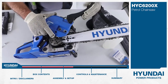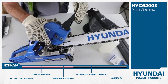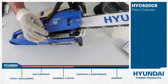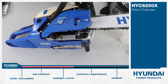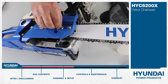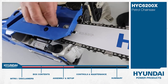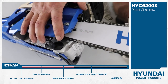So again, to fit this, we need to make sure that the brake is in the off position. I've just put this back on, but that's the off position. Away is the on. So now I simply locate this over the 2 bolts, just gently, and it should sit into position. So I'm just going to remove one of my gloves for this. I'm just going to refit these 2 screws, or nuts I should say. There we are. Just make sure that locates tidily.